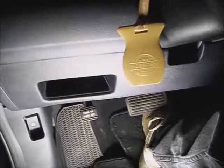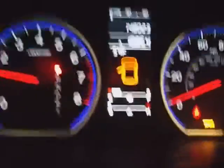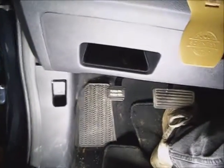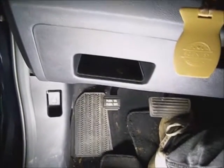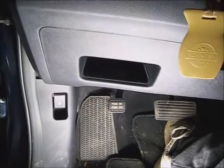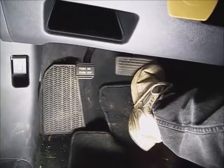I think the master cylinder is bypassing, and I think the cups are worn out on the master cylinder. The pedal's been up and down 100,000 times, that many miles, or 50,000 anyway. And the cups are bypassing when there's very little pressure load on them, and then when you reset the brake pedal, the pressure from the get-go expands the seals out enough to catch. I'll get on the master cylinder. I've got an aftermarket one here.